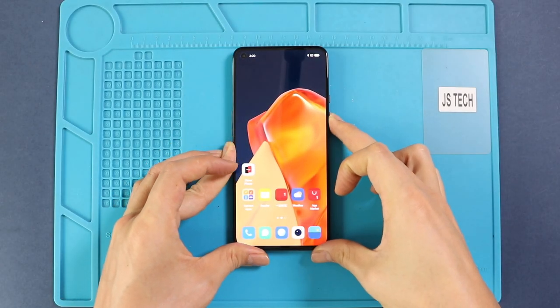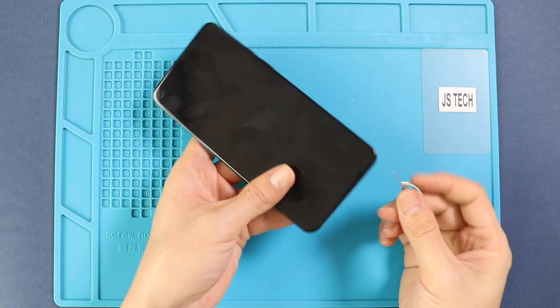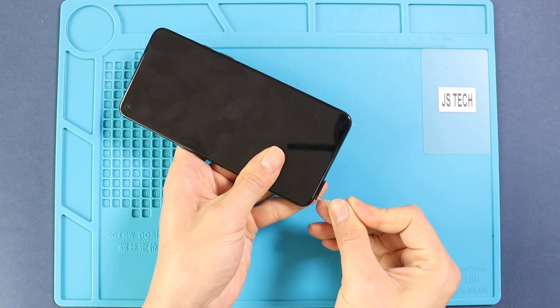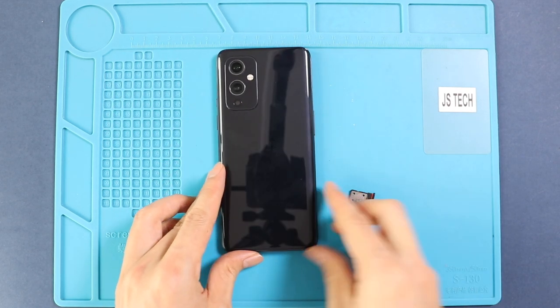Today we will show you how to replace the camera lens glass on the OnePlus 9 mobile phone. To start, we need to have the right tools to proceed with the repair, which you can find in the description. First, take out the SIM tray and then remove the back cover.